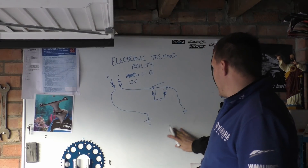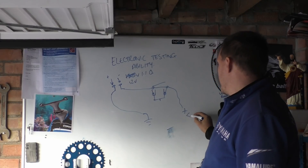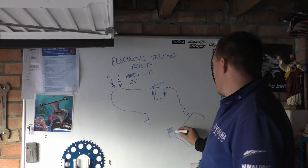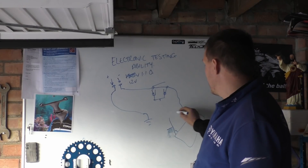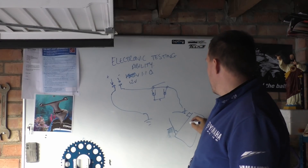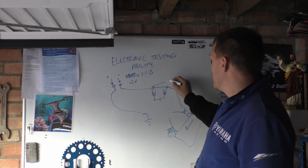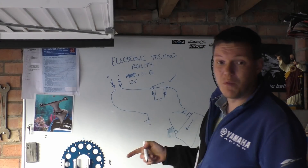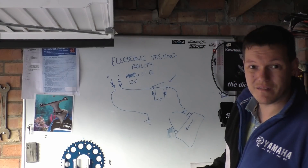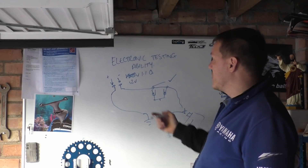You can test your switch that way. The other thing you can do is obviously test your battery — you'll have your two terminals — stick your multimeter leads on at voltage and just see what voltage the battery has. If your battery is good and your switch is good but you're still not getting power, well, there only remains one thing in the circuit, and that's the ground.